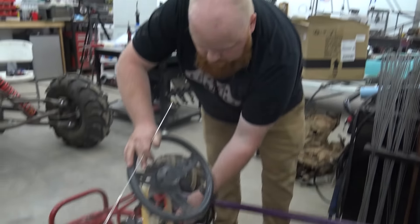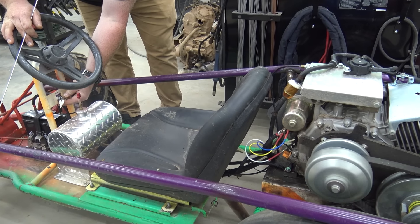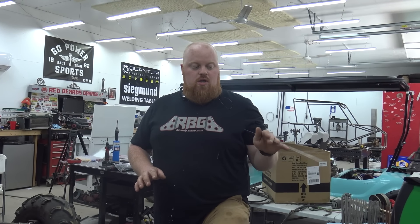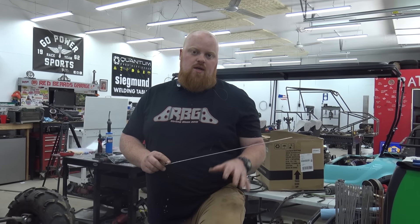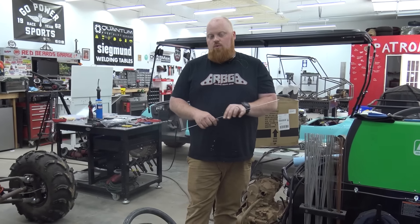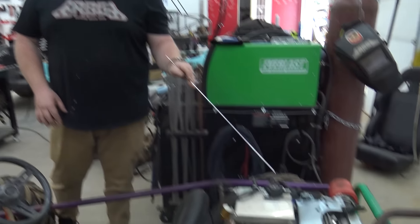If we turn the key switch over that's accessory mode — we didn't go through that on this video. If we turn the switch on over, she would fire up. This has old gas and it's been sitting a while. So that's a very basic wiring harness setup to hook up the electric start on your engine. On the next video we're going to talk about the charging coils and how to hook them up properly to charge up your battery. Right now the way this is hooked up, he's going to get no charging from his engine to his battery — we just did a basic wiring harness for the electric start. He would have to trickle charge his battery or hook up the charging system, which we're going to go over in the next video.